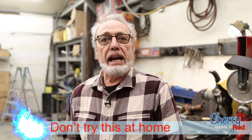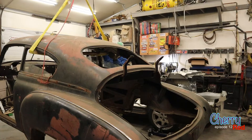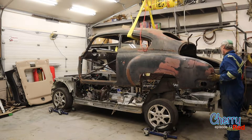Welcome back to episode 12 of 'Don't Try This at Home' — lengthening a drive shaft. If you haven't watched episode 11, you need to go back and do that, because we're taking off from a day's worth of work that got us to this point. We have the drive shaft all lined up, ready to cut — we're going to lengthen it an inch, because this '49 Chevy that this Cadillac is going under is an inch longer in the wheelbase. So we stretched the Cadillac chassis, and the drive shaft here is the last part.